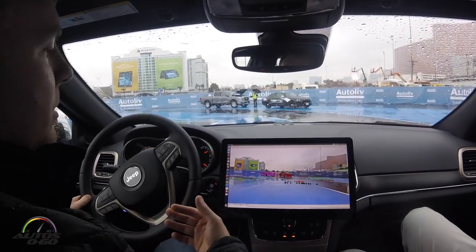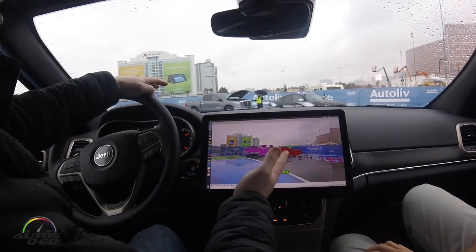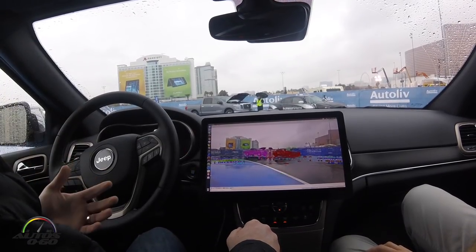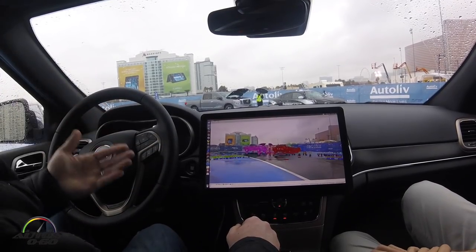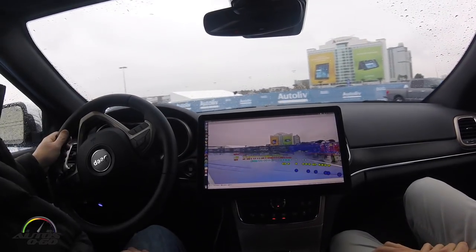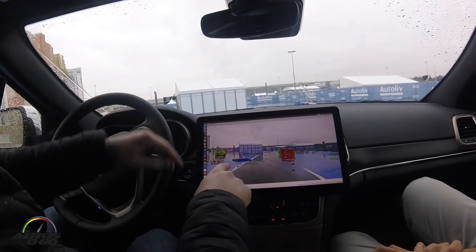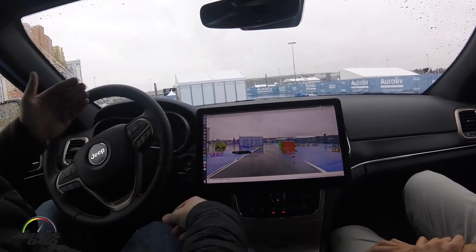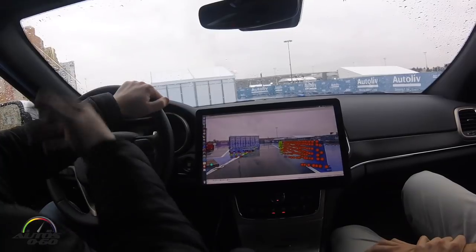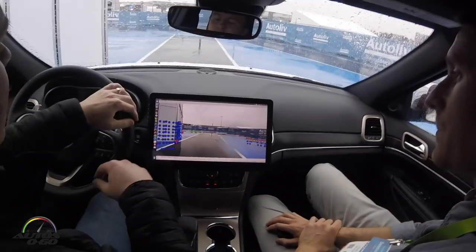With larger objects like vehicles we get many more returns, and if I removed the camera image you could still look at the point cloud and say those are clearly the size and shape of vehicles. This makes classification much easier — is it a car, a truck, a pedestrian, a bicyclist? Just from size and shape we can tell. Another example: this pallet is only about 10 centimeters high but we get reflections off the side and the top, giving us its height. In an autonomous driving context, that's something we'd obviously want to avoid — and it's the difference between that and a plastic bag on the road.